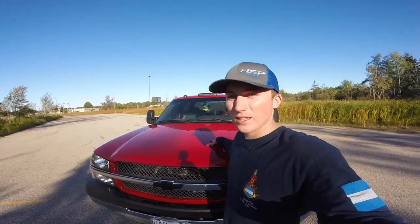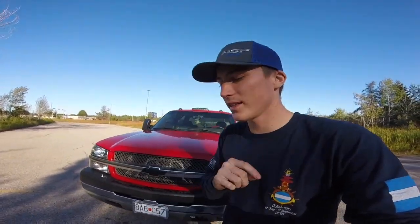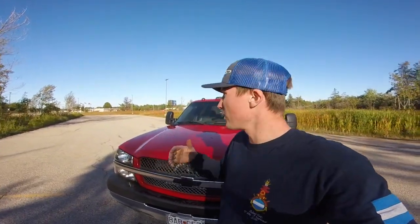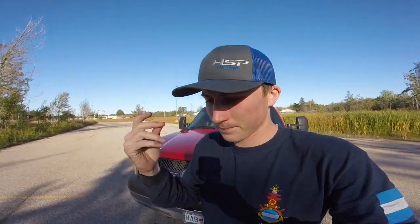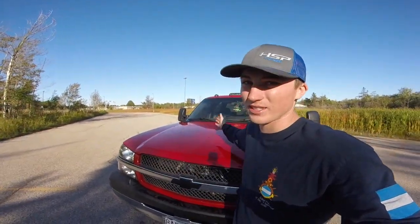All right, so after you have the hot side intercooler piping taken out, next is the turbo intake horn. Now, that is difficult. I recommend going and getting one of those flexible extensions. I think they're kind of on a spring. You can get 3/8 or 1/4 inch. If you can get a 1/4, that'd be great, just because you're going to be able to fit a lot better. But 3/8 is what we use, and you're able to get either that, or if you use a 10 millimeter ratcheting wrench, that also works on some of the angles.